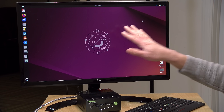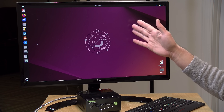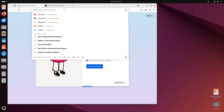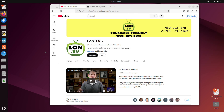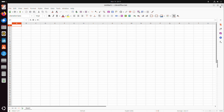For Linux, we loaded Ubuntu 24.10 and everything was detected properly — the 4K display, audio, Bluetooth, Wi-Fi, and Ethernet all spun right up without issue. Performance on the Linux side feels just as good as on Windows. I'm confident you can dual boot your favorite flavor of Linux alongside Windows, or even run multiple Linux distributions.